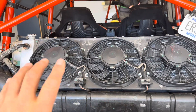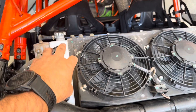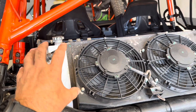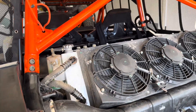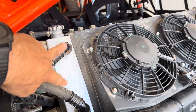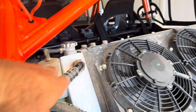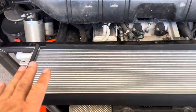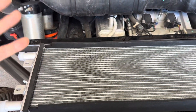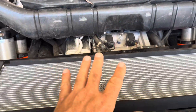So let me show you what you've got. The main radiator is the engine cooling system and it also has a built-in oil cooler system. It is separate from the inlet air temperature radiator system. It has oil lines that feed into it and also water lines. It has a small radiator cap and an overflow system. The intercooler heat exchanger radiator — or whatever you want to call it — is bolted in front of that. I've got it out of the car right now.